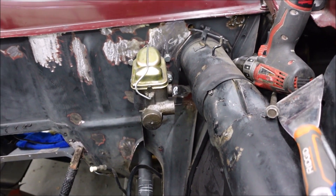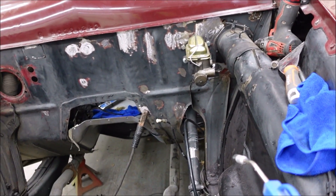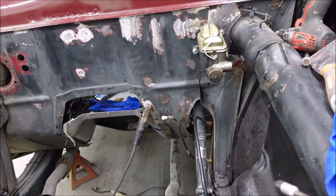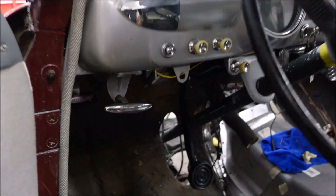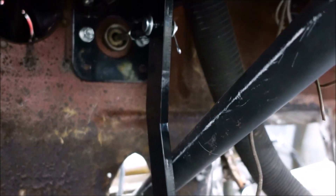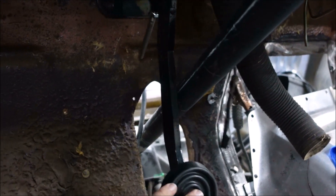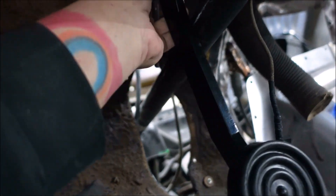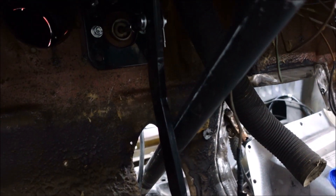As you can see, it's all completed except for the brakes — a bunch of fluid came out of the side of the master cylinder, so we might have something going on there. Got some holes welded up. All we have to do as far as this goes is come up with a stop for the pedal, so the rod that bolts to the firewall doesn't go back and break to the dash. The only problem is if you really gas on it — oh no, no brakes. We just have to put a stop so this pedal can't come back and have the rod fall out.